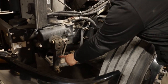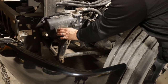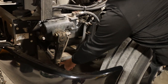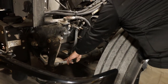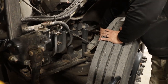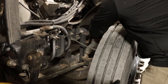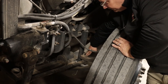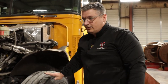I'm going to come down and check my Pittman arm, making sure it's securely mounted, it's not cracked or bent. I'll check to make sure the castle nut and cotter pin are in place and secured. I'm going to check my steering linkage and the tie rod, making sure they're in place, they're not bent or broken, and the castle nut and cotter pin are in place and secured. That is what is unique to the driver's side. We are done with the engine compartment.